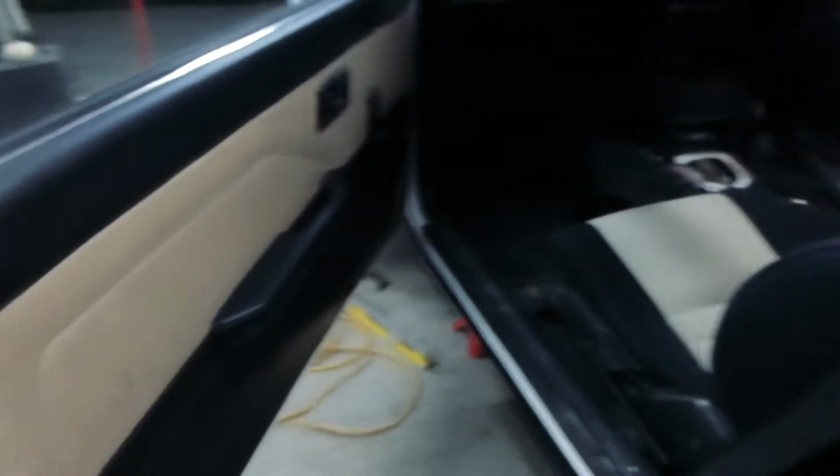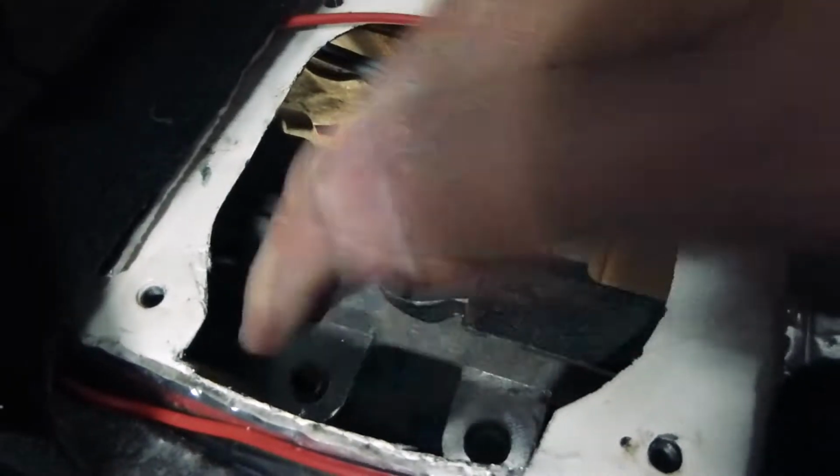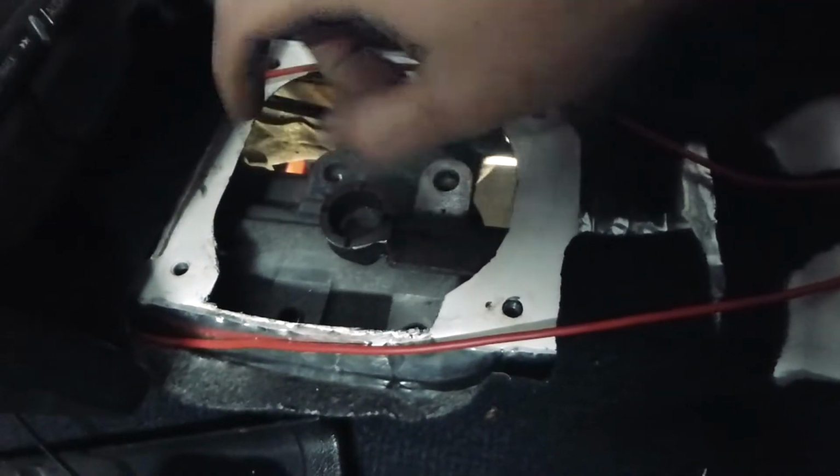Starting on the shifter mechanism, you can see there I've taken the standard one, I've actually lengthened the hunk of steel on it, and that then pokes through to the inside, and we get a shifter location on top of the gearbox, on top of the 4 bolt holes. So in one of my previous videos I talked about doing this. I did try to see where the standard shifter came out, and that came out right back here somewhere, so we've gone for the option of having it in the actual centre of the hole.